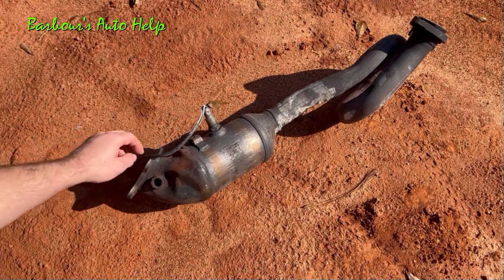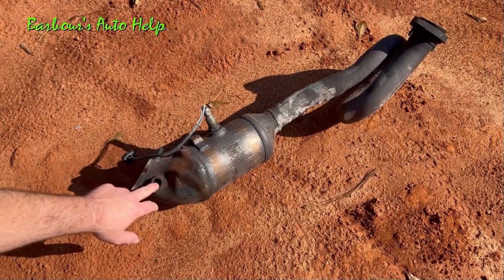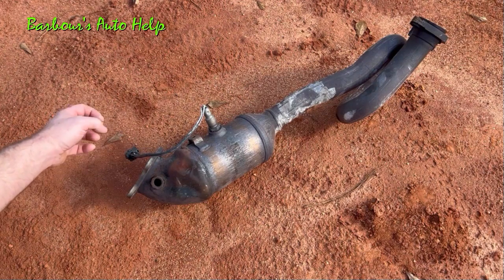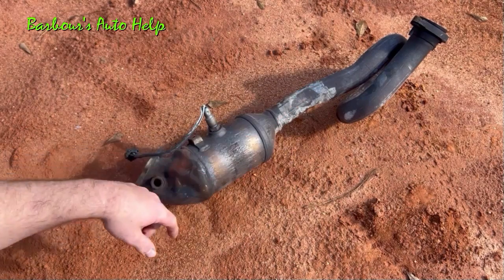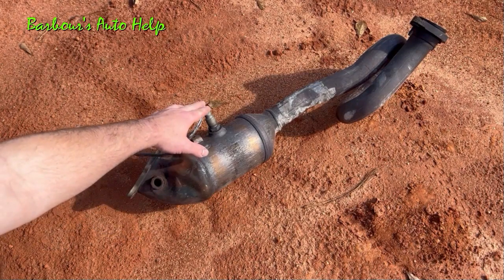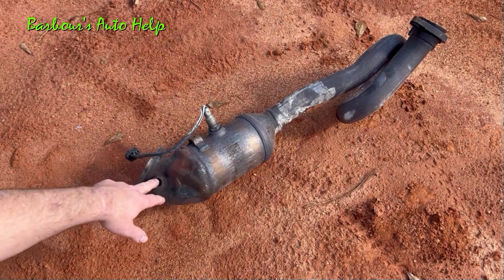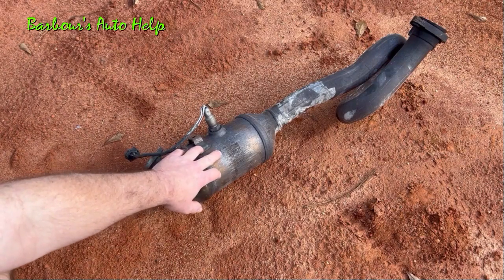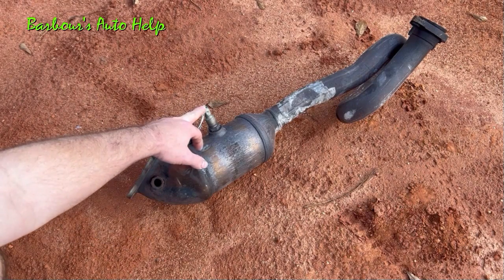What you're looking at right here is a catalytic converter. You can see an O2 sensor right in the side of the catalytic converter, and also a position where an O2 sensor would have been placed. This part of the catalytic converter is the flange that mounts up to the cylinder head, which has the exhaust manifold built into it. So this would be upstream, and down there would be downstream. This would be your upstream O2 sensor — sensor one. And that would be your sensor two, or downstream O2 sensor. Sensor one is always going to be in the flow of exhaust gas before the catalytic converter. Sensor two is always going to be either in the catalytic converter, just past the first part of it, or just after it.